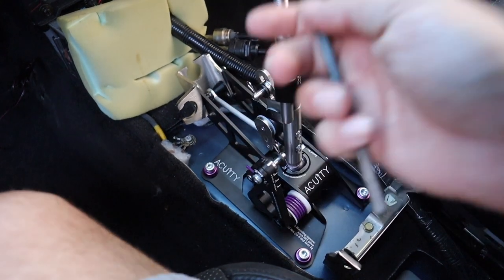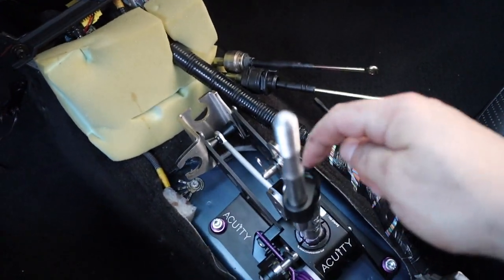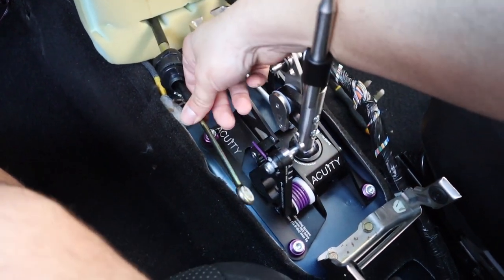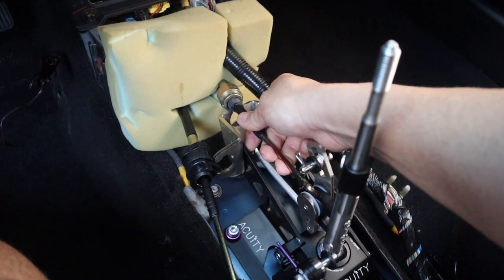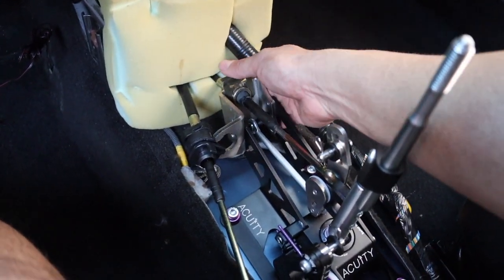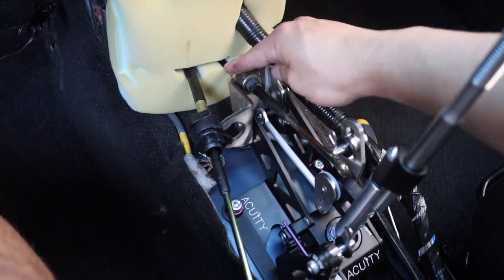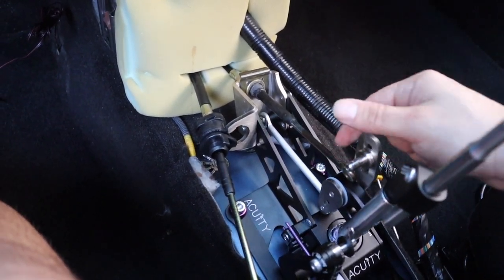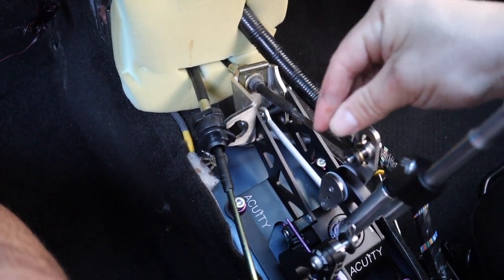All right, so I'm using this allen key here and also another one that's a little rusty but does the job. There's also the adjustment for the shifter — I'll get into that in a minute. For the cables: this one goes on this side, that one goes on the other side. Basically you just push them back, slide them in and they will fall in. Push it a little forward and that's it. For the clip, put it in by hand then give it a couple of taps with a rubber-handled screwdriver and she's in. Remember it has a washer — be careful not to lose that washer.